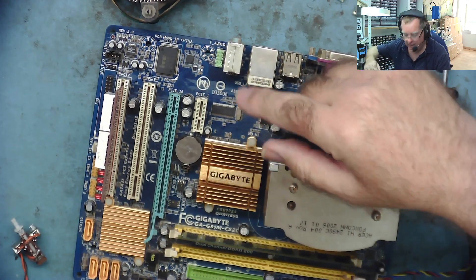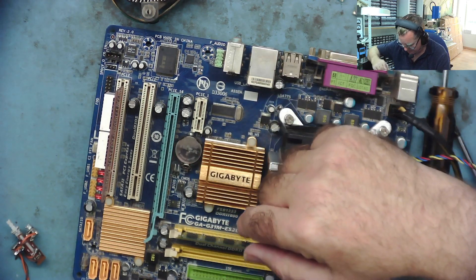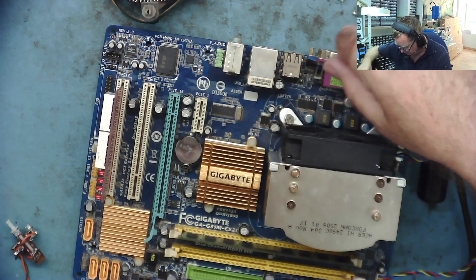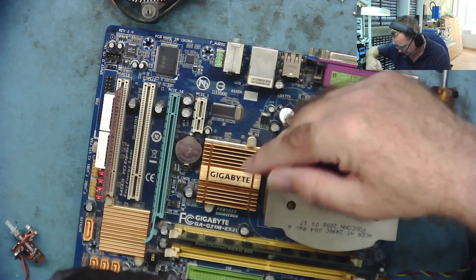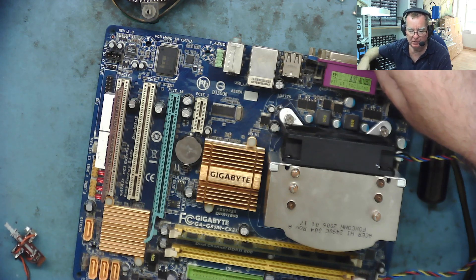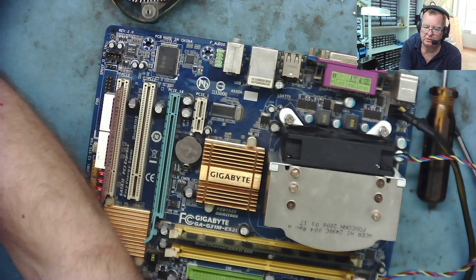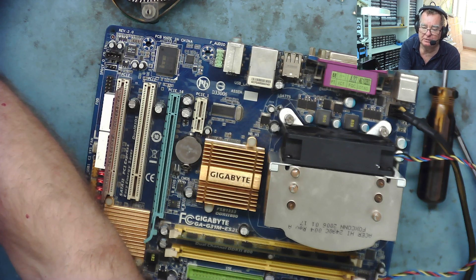I've got another motherboard the same as this, so what I'll do is let's just check to make sure the CPU and the RAM are okay. If they are, I might try reprogramming the BIOS on this. Sometimes I've seen if a BIOS can't read, it just sits there doing nothing. You can find that by taking the BIOS off and trying to boot the board. If not, I'd probably just swap this board - it'd probably fill the cost of it, I'd just give them the other board. Okay, let me get one and make sure the CPU and RAM are okay.